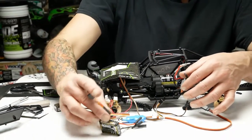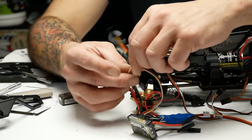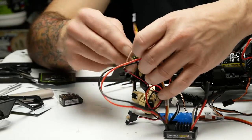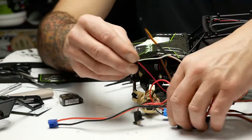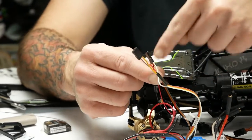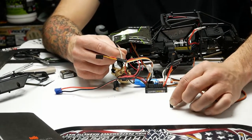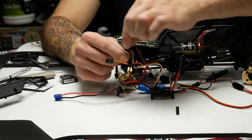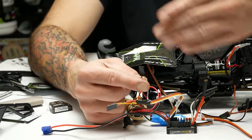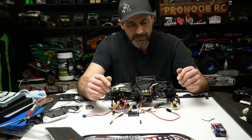And then on the fire wire, if you would, the one that controls the ESC, we actually just fix this mess here, whoops. This is the white wire that would hook into your ESC. We actually took the plug from the other one, which is just a 2 instead of 3 little block there, and we unhooked the wires, put them into the other space that was available on there, so now the front lights will get power too. So just a little bit of thinking to get that done.